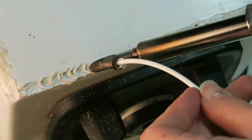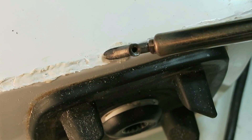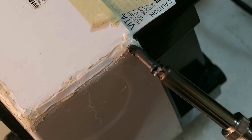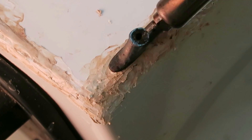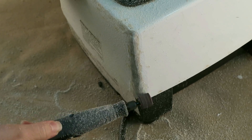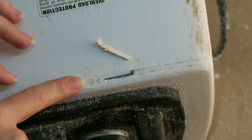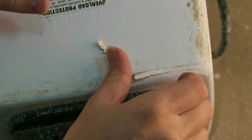At this corner the temperature is still low, but I'm putting in the time and effort to melt the armadillo into the blender plastic. By the final edge, my hand is getting very fatigued because I've been applying so much pressure to mush and melt the pieces together with the relatively cool hot end. I have to kick up the heat a tad to get the job done. After turning the heat dial only slightly up — still below the lowest preset — the filament residue in the hot end continually burns black no matter how many times I clean it out. As I'm sanding away the excess plastic, I can see how uneven the thickness of the weld is and how poorly adhered it is where the temperature was lowest and the parent plastic was not melded with the filler. This shows that it is truly important to melt and mix the parent and weld plastics together.